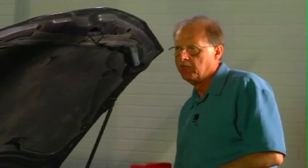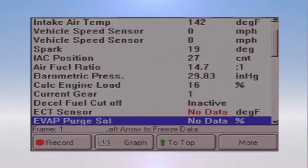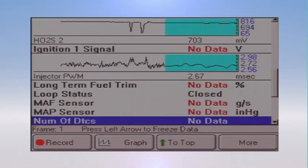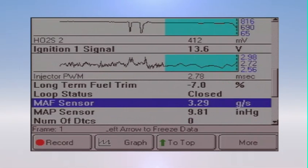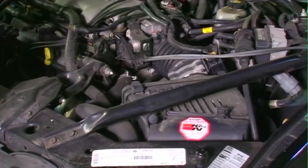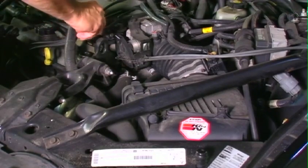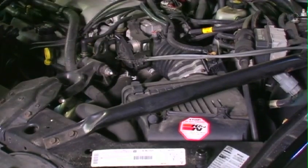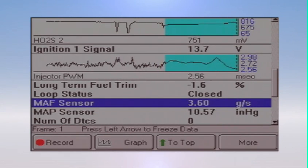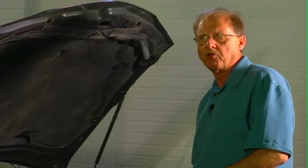If you're looking at mass airflow sensors, one other thing to keep in mind — I'm going to scroll down and pull the mass airflow sensor up on the screen. Grams per second. Right now I've got 3.28 grams per second. On a good running car with a 3.4 liter engine in here, I should have 3.4 grams. I've created a slight vacuum leak. If I put it back in the crankcase, it automatically goes to 3.63. So a slight vacuum leak drops my grams per second down, so we know it's there.